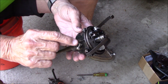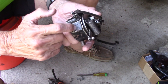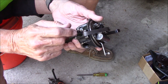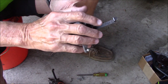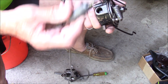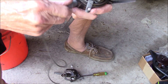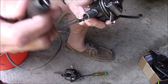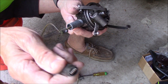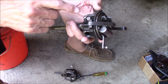You ought to put these in all of your distributors. If you get into a problem, simply connect this to the passenger side of the coil. If you can get this component out, just take it out and not use it. Turn your key on with a jumper from here to the passenger side of the coil and that will operate your car quite well. The same thing works with the screw-in part with an alligator clip on the other side going to the passenger side of the coil — it bypasses your switch.